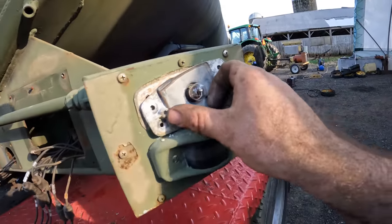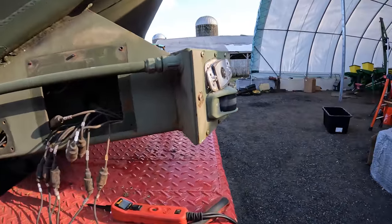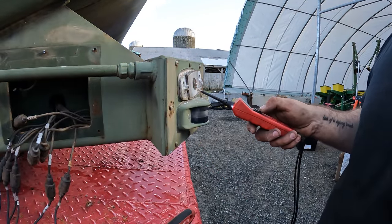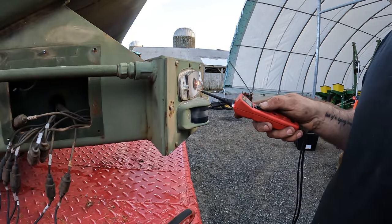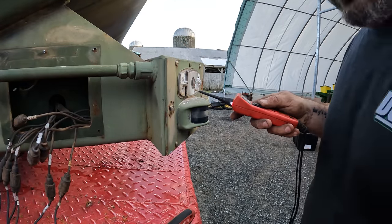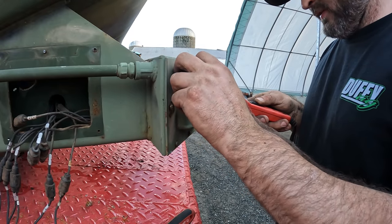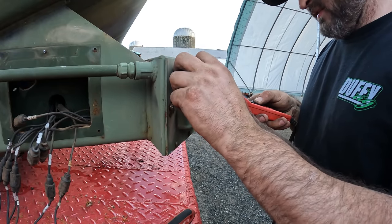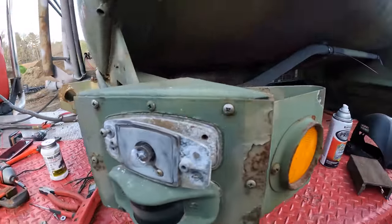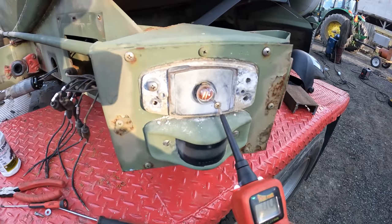We changed the grounds because it would not work if this ground was hot and the truck ground was not. Right now it's got voltage, but it just doesn't have a good contact. Let's see if we clean one up — I'm going to have to do a lot of cleaning. Got a lot of corrosion on it. But it works — it's plugged in, it just needs a ground to it, and the light turns on.